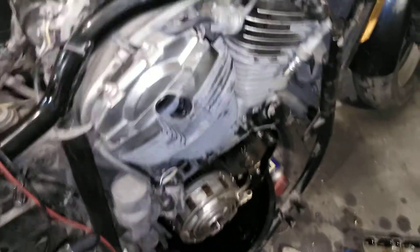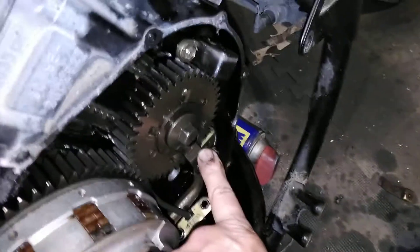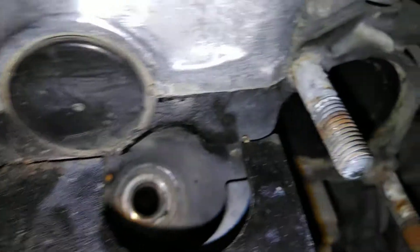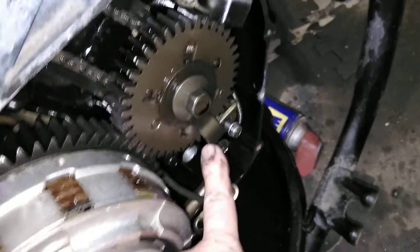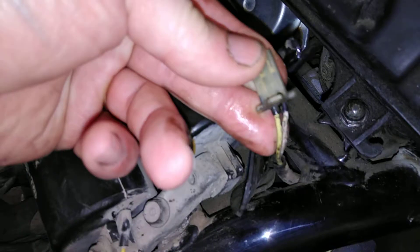The front one is the bottom one right here. I know because I put it on there — I stuck a screwdriver down through the spark plug hole and touched the top of the piston. When it's pointing down it is top dead center for the front piston, and when it's pointing here it's top dead center for the back piston.